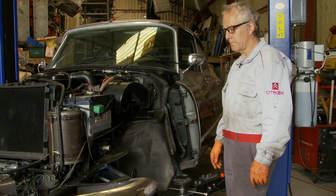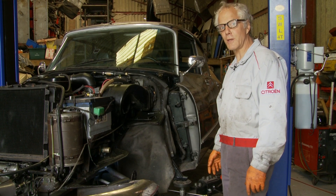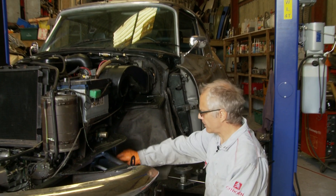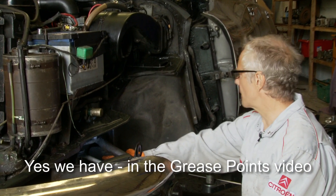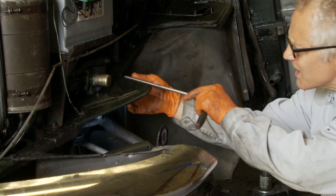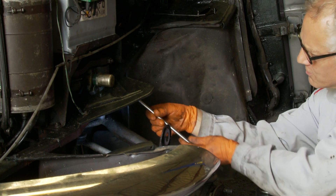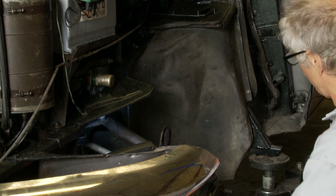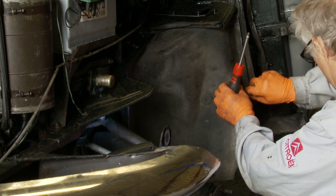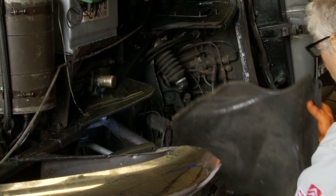In order to adjust the parking brake cable, first of all you have to remove the wing, which we've covered in another video. Then you have to remove this panel. It's got three bolt fixings — M5s down here and two screws at the back. I've already moved most of them in order to save time. It is the usual Citroën of being slightly awkward, and the panel then just lifts off with a little bit of ingenuity.